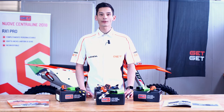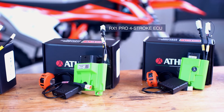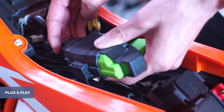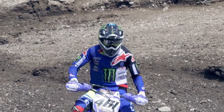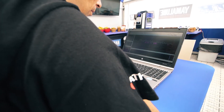There are basically three main product families where we've been focusing: two-stroke carburetor CDIs, two-stroke fuel injected ECUs, and four-stroke fuel injected ECUs. All these electronic units are plug-and-play, as they come with the same connector of the standard CDI or ECU, and they are developed to maximize the performance of a fully standard bike or a standard engine with a racing exhaust. All these electronic units are fully programmable using the engine management software called Maya.